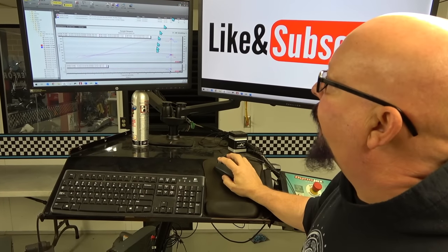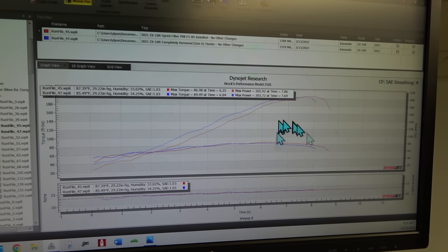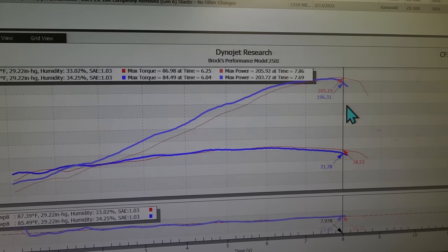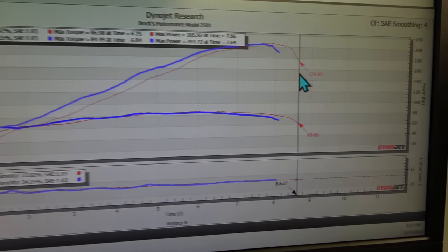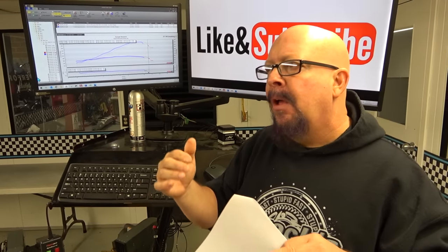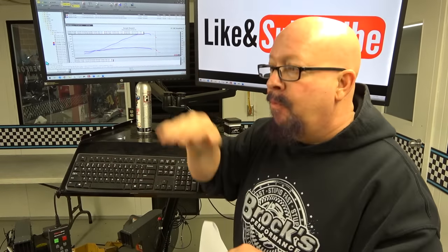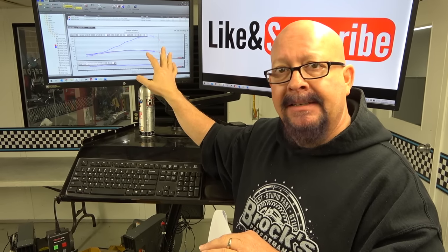So let me go over here and change the scale from RPM to time. With no other changes, the Gen 6 combination, which is this, look how much, by the time to hit the red line, that took 8.06 seconds. When we pulled the stacks out, it took all the way to 8.6 seconds. So that just gives you an example of how much quicker the Gen 6 optimized configuration moved through the RPM range than pulling the stacks out for a combination that really isn't suggested.